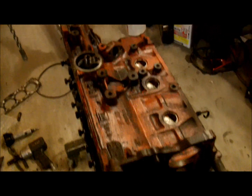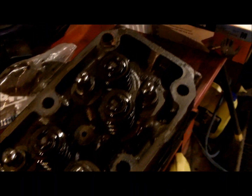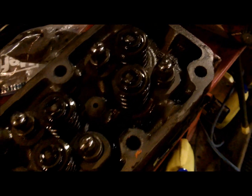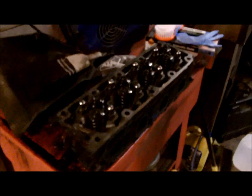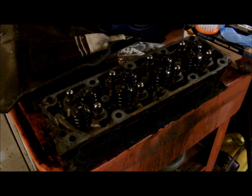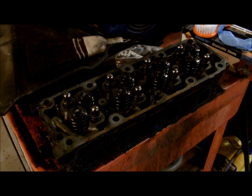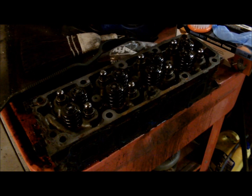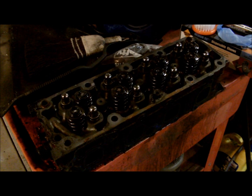How a 1986 motor ended up in a '77 car — that's probably a mystery. Here's the cylinder head, which also looks pretty clean, minus the dirt it got on it — not crummy or sludgy at all. It's filled with oil so I'm not going to flip it over. This has the heart-shaped chambers — it's actually an HO motor. Although these are higher horsepower stock, I actually prefer the open-chambered heads because they should flow a lot better at higher RPM.